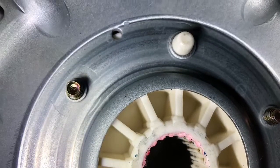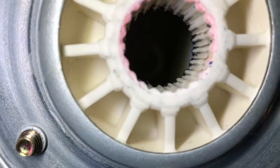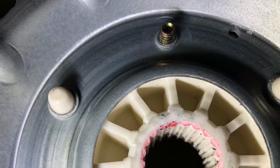Here are some close-up pictures of the splines on the rotor that were worn out. They're just a little bit rounded - that's because the metal abraded on them and that's why it got the LE error. Thanks so much for watching and please subscribe when you get a chance.